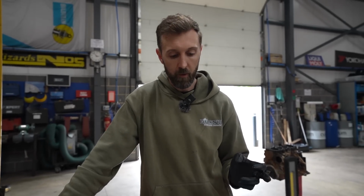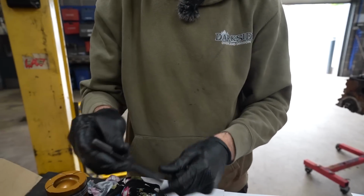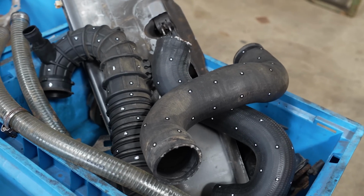with cutouts so we can stick cams and big valves in it. Key things we wanted to try on here that we've not done before are the hybrid turbos. We're going to stick a CP3 pump on it. Fuel rail pressure sensor, we've got a little upgrade for that. Set of ARPs, so head studs, oil cooler, intercooler hoses and intake pipe.